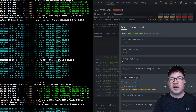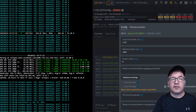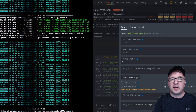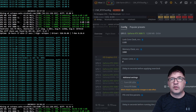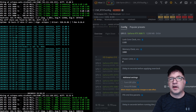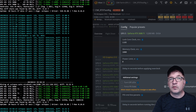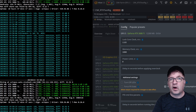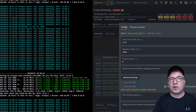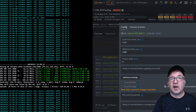The last card I tested is one of my favorites — the RTX 3080 Ti, and it did great mining Octopus. Using a locked core clock of 1185 and a memory clock offset of +1000, I'm getting 105 MH/s using 302 watts. I'd be really happy with this result, but I know from my original testing that the fans and RGB are not included in the power reading, so it's probably running 30 to 40 watts higher than what the miner is showing. These are my overall mining results and I'm really pleased with them compared to the stock values I was seeing from tools like WhatToMine.